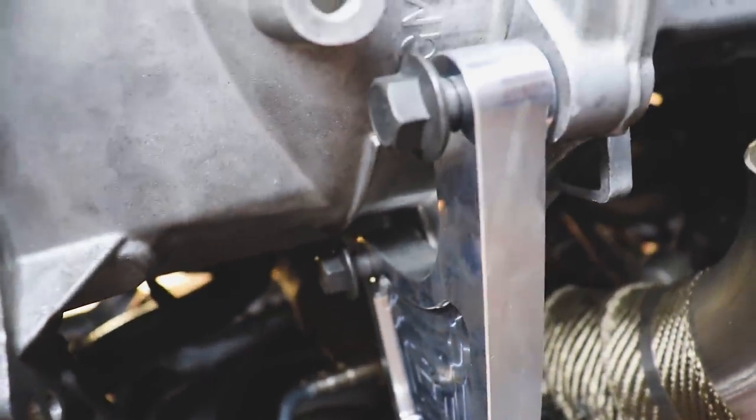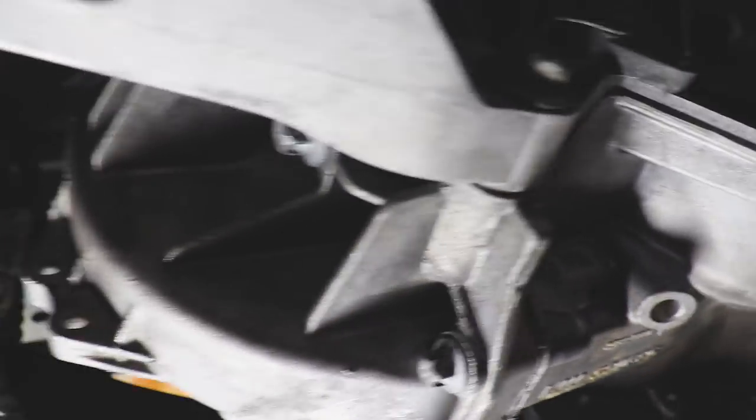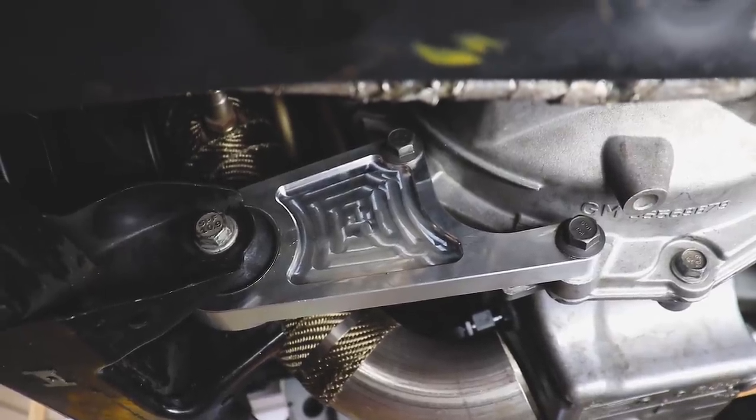It's another day. We have the transmission in, everything's hooked up, the subframe is on. Now let's finish installing those reinforced transmission mounts. Here is the front mount — everything just loosely in there with a little bushing spacer. Here's our second mount towards the back — it too has a couple spacers since these are narrower. I needed to jack the transmission up a little bit to get the holes lined up. It did take some finagling with a pry bar but not too bad overall.